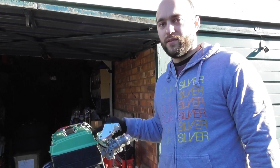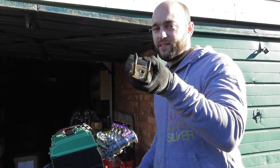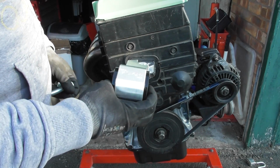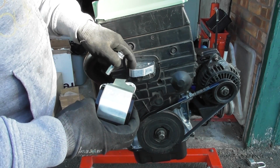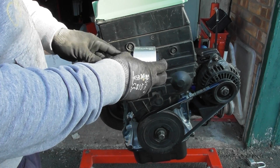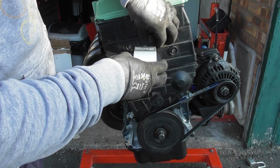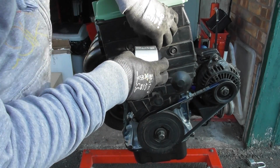But the rest of this video, in terms of mounting the cover and the engine mount, I'll just use the standard B18C4 bracket for the MB6. So this is the Hasport left side engine mount. I've already put the left side bracket on there, and what you notice in this side, it has a threaded hole, and this side it's a non-threaded hole that you shoot straight through. So all you do is you put it in there like this, put the non-threaded straight the way through, which is a longer bolt, and the shorter bolt, make sure you have washers on both, and the shorter bolt just goes in here, and just thread that up like so.